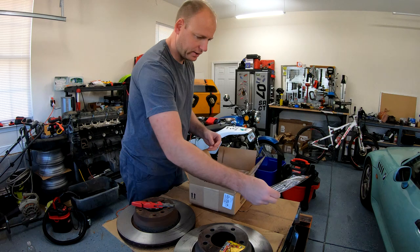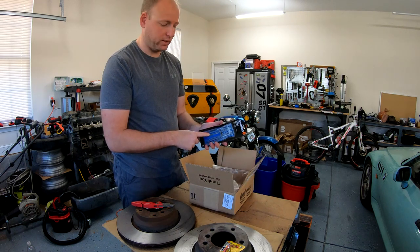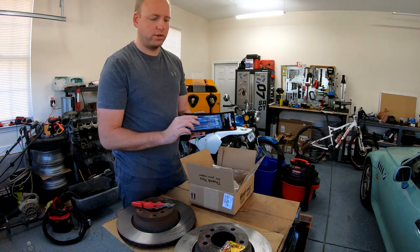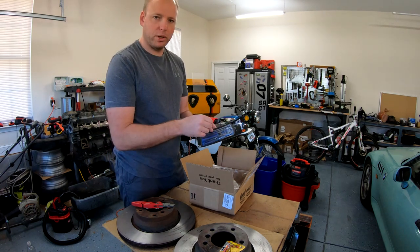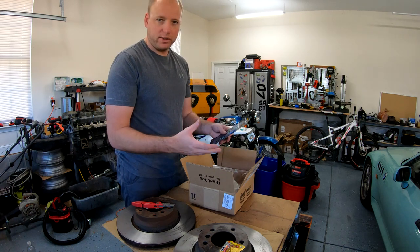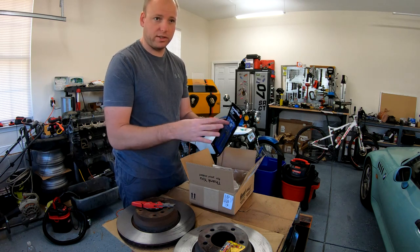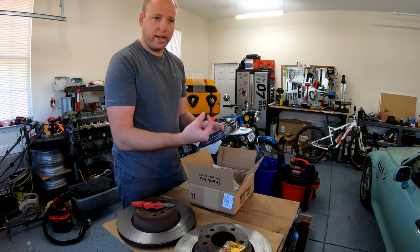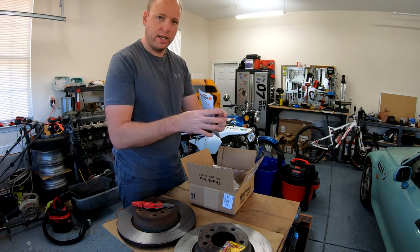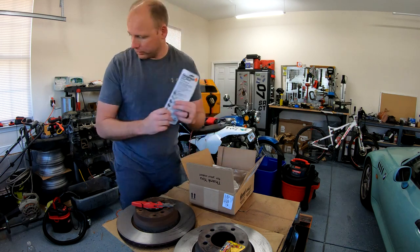I got a set of files for the piston rings — I'm going to use these to clean up the burrs on the piston rings when I re-gap them. Turbo engines running under higher pressure and more heat have a tendency for the piston rings to expand more, so you want that gap big enough so when they expand the two ends don't run into each other and bind, because that's how you can really destroy your engine.